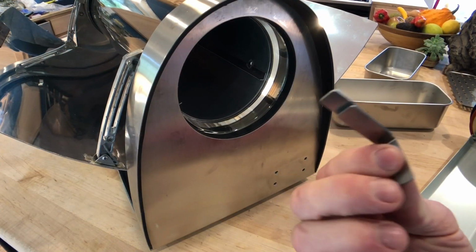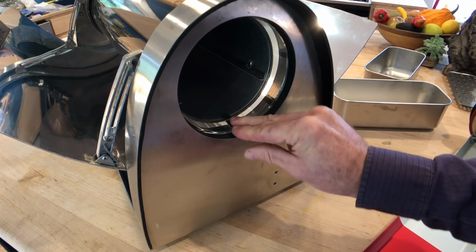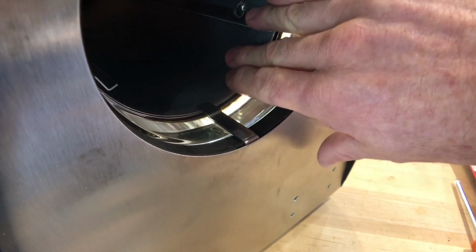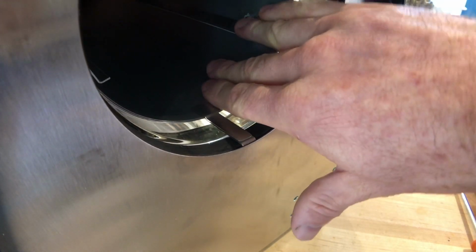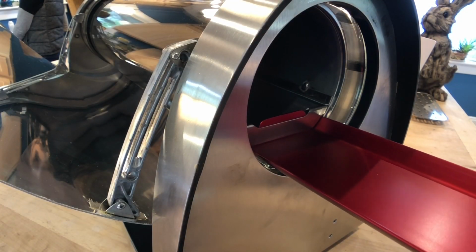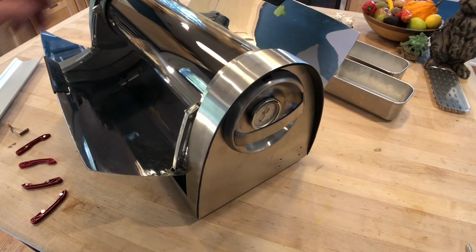But to keep the remaining shims in place inside the tube, the new metal brace is added into the same slot that you just pulled the old one from. Some adjustments to the shims are often needed to establish connection between the new metal brace and the inner shims. Your upgraded grill is now renewed and ready for action.